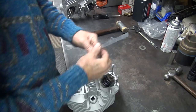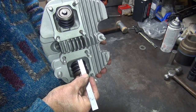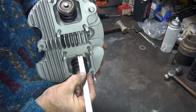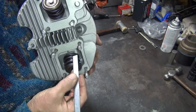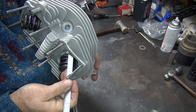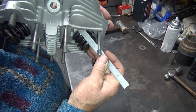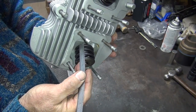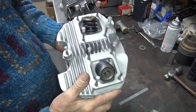On the intake you don't hear it pop and on the exhaust you do — but I guarantee you they're both popping. These need to be 425 on both. We are over — about a good 350 over 450 it looks like. Excuse me, wrong number. This one here we're a lot lower than that. I just can't measure it very well over there. Obviously had a false number on that side. We're at a 340-ish area — looks good when you can't really see the surfaces, you've got to kind of guess. Alright, so that's all done. Should run pretty good.